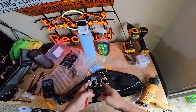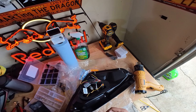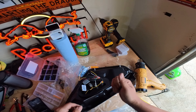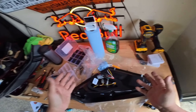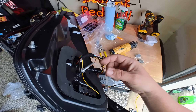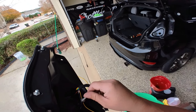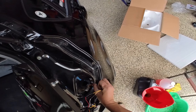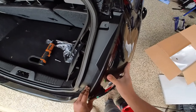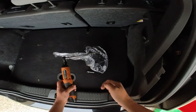I'm going to finish up this wiring harness — and I've got to say, you guys are going to be stoked, these look really good especially on tuxedo black. I picked the smoked one. Let me finish up this wiring harness and install these lights, and then we're going to show what the sequences look like and get up close to the fitment. Another thing I forgot to mention: there's a little screw pin that aligns to a different year of Fiesta — you're going to want to remove that, it's not needed. Feed it through, align the alignment pins, and snap it in — goes in nice and flush, everything lines up correctly.